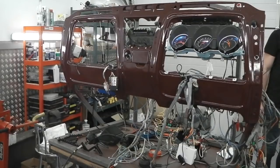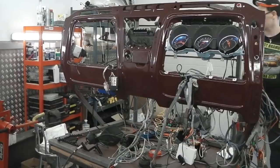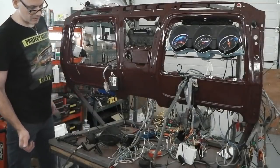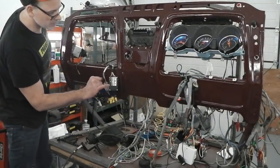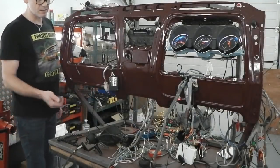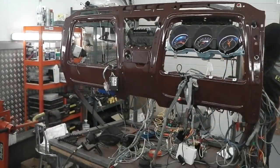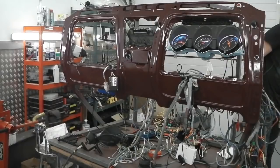Cruise is cruising and now dropped out. Locked the speed out. We should have lost the lockup as well. Cruise lost the plot because it didn't like the varying speed. Yes, lock converter's dropped out. Let's lock back onto a higher speed. Let's go for 60 mile an hour. 60 then.